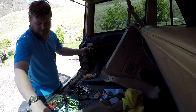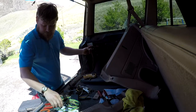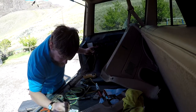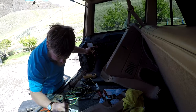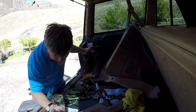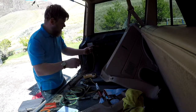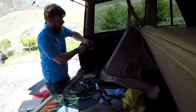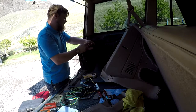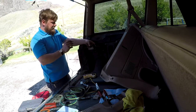Okay, write it down. Okay, so two white brake cables, brakes. Okay, so I found our ground, so that black is ground. All right, turn on left turn signal. You're gonna put two clicks for it, I think.